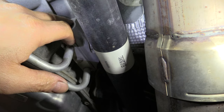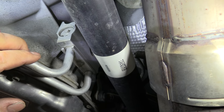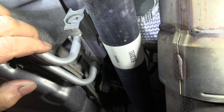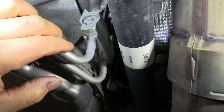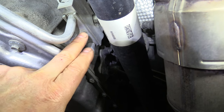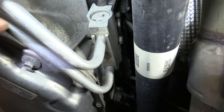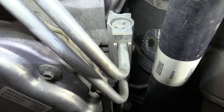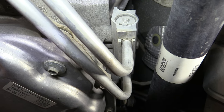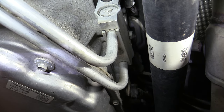It's kind of a bad deal because if you live in a place where they use road salt, that stuff gets in there and starts eating away. Right in here at that plug there's an aluminum cap. If yours is vertical, you're going to have to take it off in order to get the snap ring out — just take it out and do it on the bench. But this one here I believe I can just do it right here, taking out the snap ring. If you do have to take it off, the two O-rings I'm talking about go on these two lines right here, there's one bolt that holds it. The other seal goes between the transmission body and the body of that thermostat — just a single aluminum-type gasket with some silicone adhered to it, and one bolt holds it on.